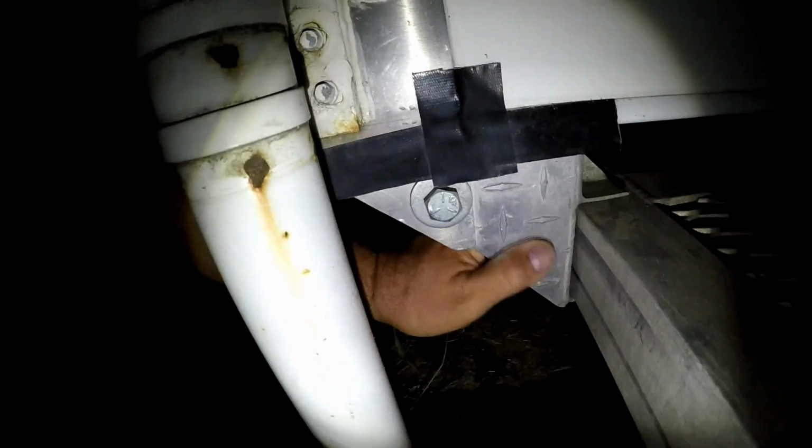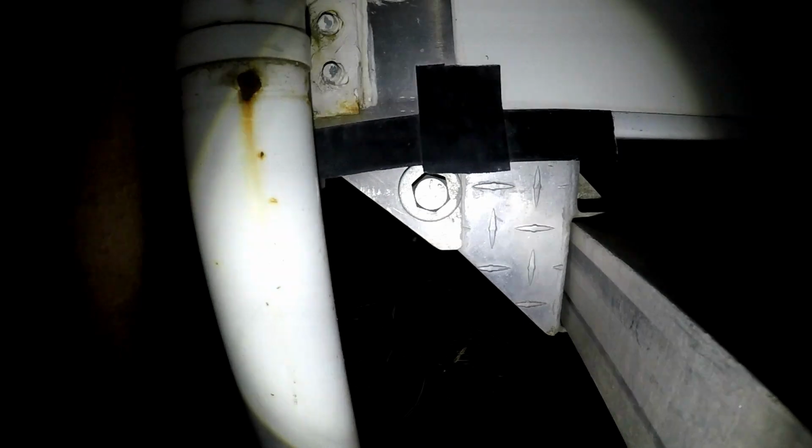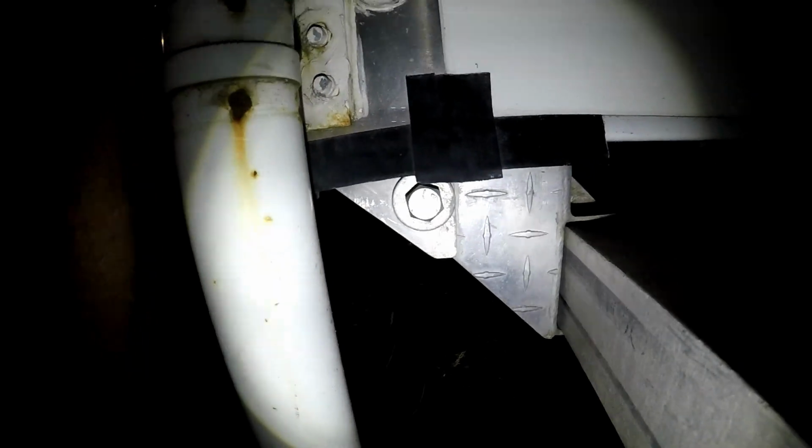I have these stainless steel bolts that go into the wood, but also the corner angle piece extends down below the truck camper to the mount bracket, and I drilled through the mount bracket and put another 1/2-inch galvanized bolt there, and that made the deck completely solid, and so we can put weight on this thing and there's no concern about it.